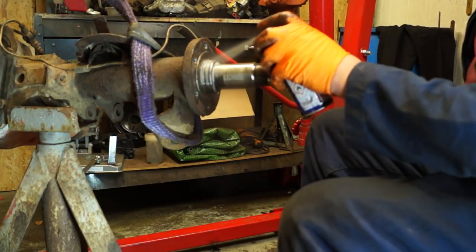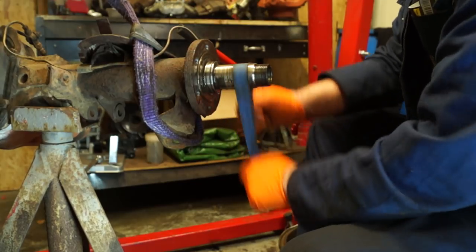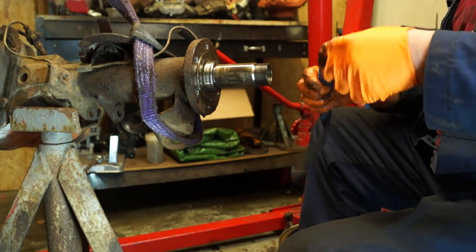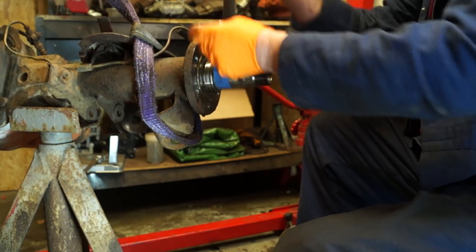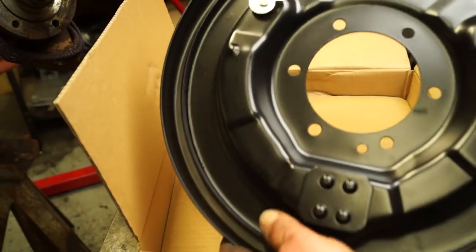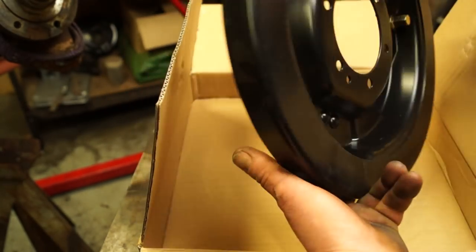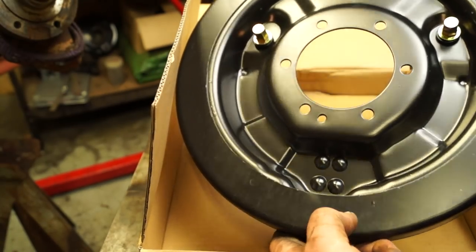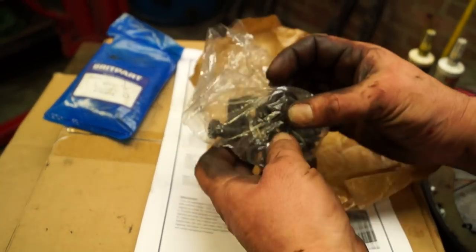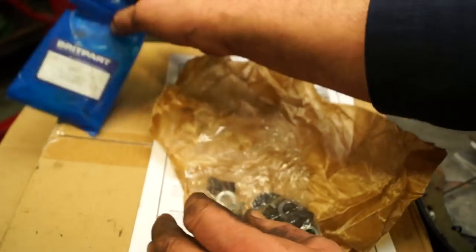Presuming you've taken your backing plates off, you're in a good position to either replace the stub axle or dress it up. What I mean by dressing is getting a fine piece of emery cloth — 120 grit — using some WD-40 and just smoothing it down again, basically just taking the old dirt off it. This is a Brit-Part backing plate, and it looks the same as what came off. You have your snail cam adjusters, wheel cylinder fits there, and the fitting at the bottom for the shoes. Obviously the 110 is different to the 90. I didn't see an issue with this at all, and we have some new adjusters as well.